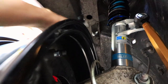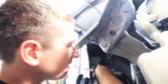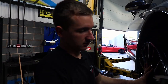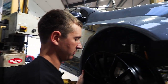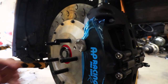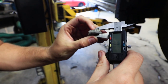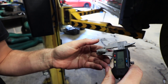Physical wheel, we've got like 50, 57mm roughly to the strut - so that's plenty. Then I need to switch that to zero, pull that back off. That is 10mm - absolutely bang on what we expected to have with ET28.